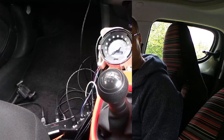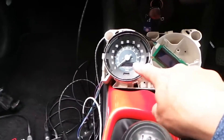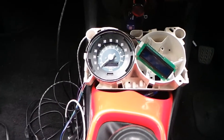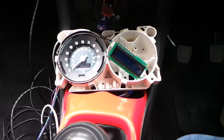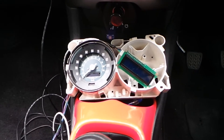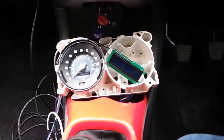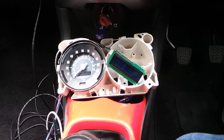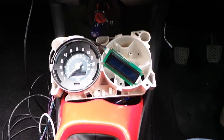Let's just have a look at the equipment we've got. Here we've got the speedometer modified with a stepper motor driving the pointer and the little OLED display displaying the mileage. Just to the right there we've got the LCD - it's just a 1602 with I2C interface. That's there to replace the ashtray on the classic mini where we can look at a few bits and pieces of data. The speed will be read out digitally there as well.